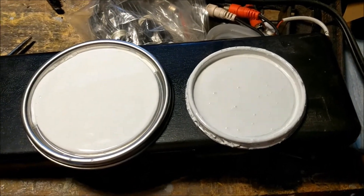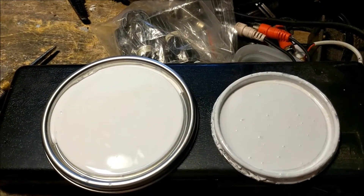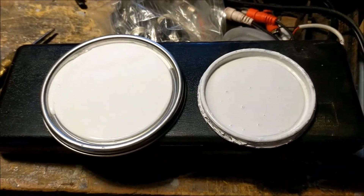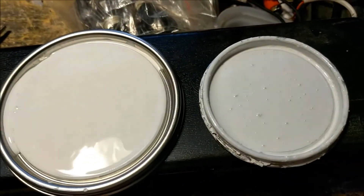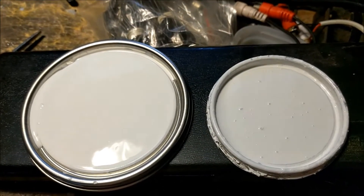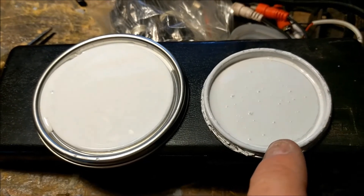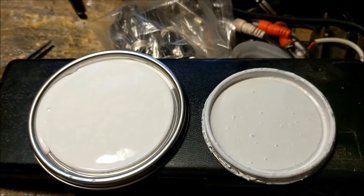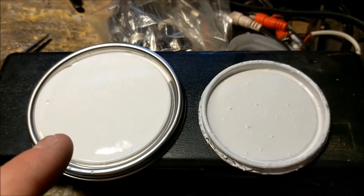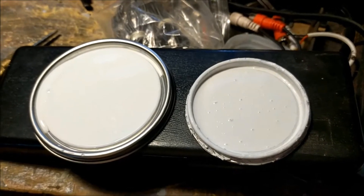On the left is the white paint from coatingstore.com - their super bright white. On the right is Mopar or Chrysler PW7 which they call bright white. So you've got super bright white versus bright white. It probably looks better on a TV screen, but this one is definitely a little bit brighter of a tint. You could lay the PW7 as a first one or two coats and then go over with the super bright white - get away with that no problem to save some paint. This one hasn't been mixed yet so it's still thick, but this one's already been reduced and ready to spray.